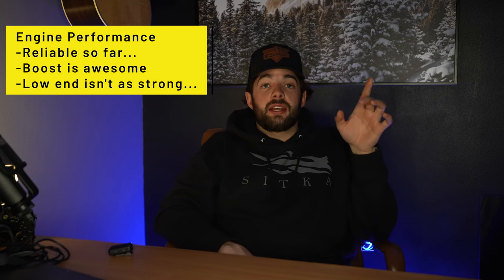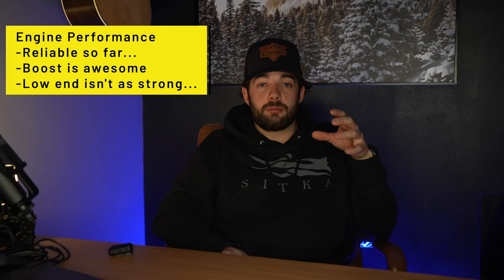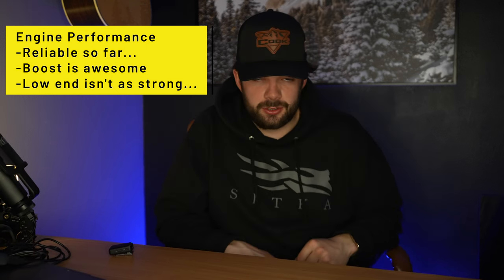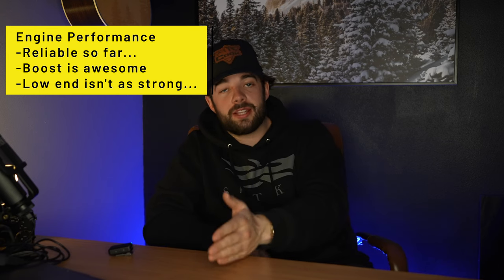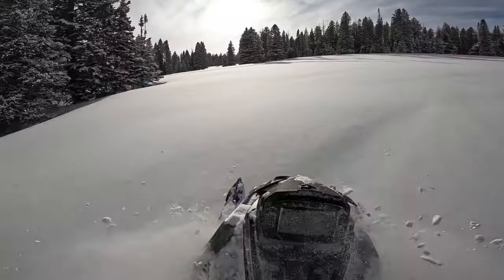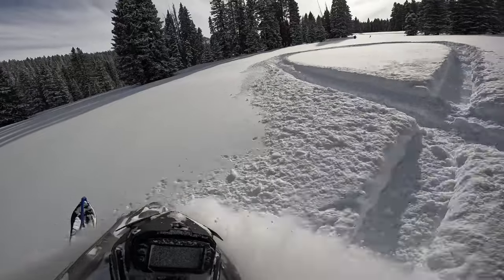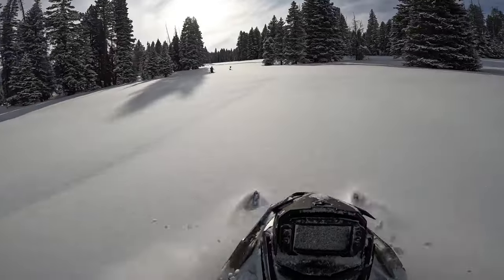The engine is very strong. This boost is not near what an aftermarket Boondocker kit or av gas kit is — I was running a Sidekick pump gas kit and this feels weaker, to be honest. But I would rather have the Matrix chassis with lower amounts of boost than an Axys chassis with high boost. With the Walker Evans shocks, Chaos rails, and the tunnel — it's awesome. The boost comes in considerably later than what a Gen 4 Ski-Doo Turbo feels like. The Ski-Doo has way better low-end in my opinion, but for me that's not a big deal. I know I could fix this with a gear-down kit.